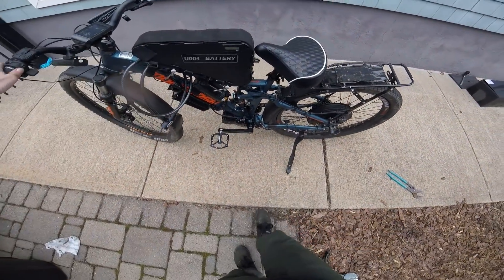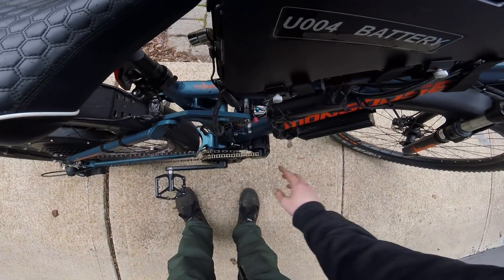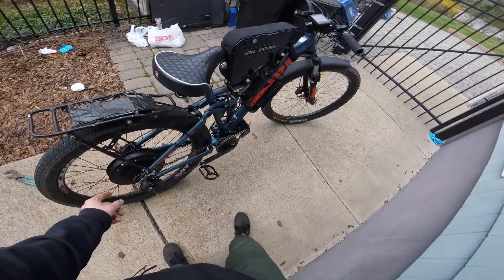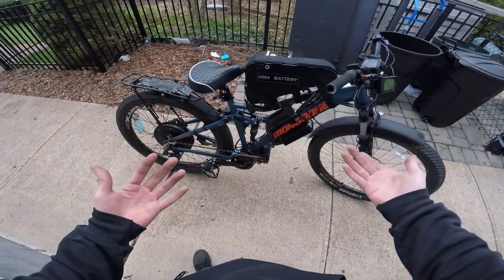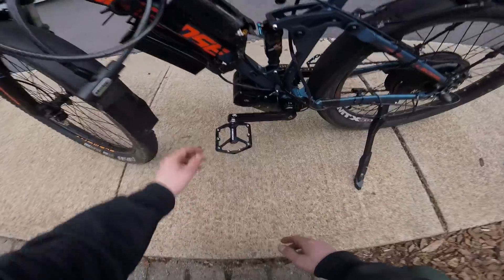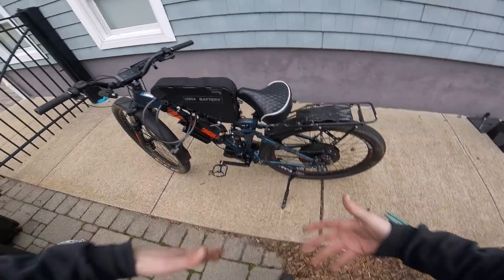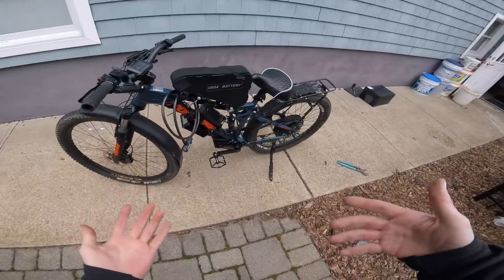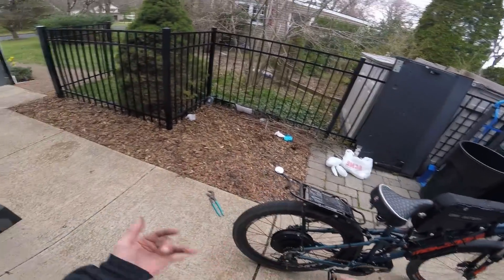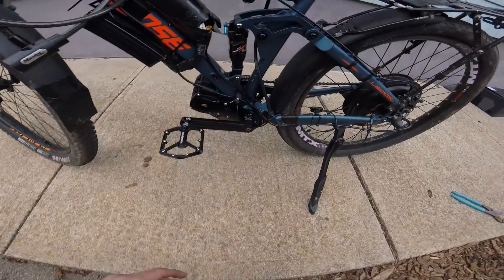So what did we learn from the first test ride? The system is a lot more complicated than the hub motor. The chain wasn't perfectly aligned, which was making a lot of noise, and I also have to adjust my derailleur. But once everything was properly aligned, the power and acceleration were there — it felt very nice. The noise level wasn't anything crazy, it looks great, and the build quality is solid metal throughout. The motor is a little warm after a short ride, but this is just the beginning. I'm going to have a lot of future content on this motor, including top speed, off-road riding, and more — make sure you're subscribed to the channel!